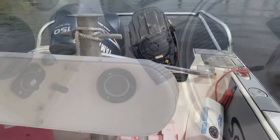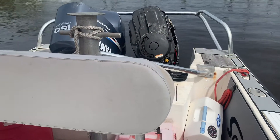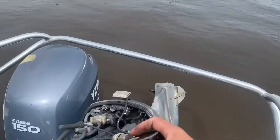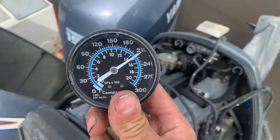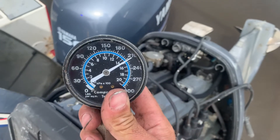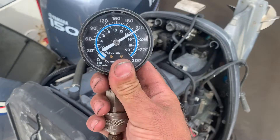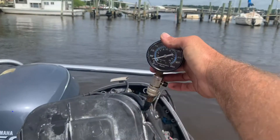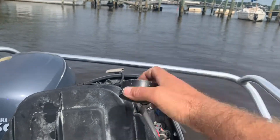I've now got compression on the first cylinder and I'm showing about 210 PSI on the top cylinder, which is a good baseline pressure. I'll thread it into the next cylinder. I've got my number two cylinder ready — pressing the pressure release to make sure everything is back down to zero before turning it over.